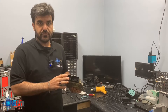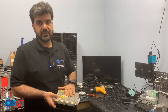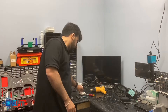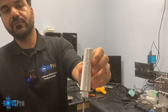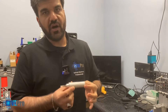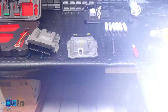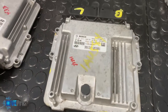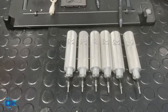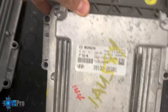We are not going to connect through the pinouts. For these Kia and Hyundai ECUs you require to open up the case in order to connect what's called boot mode. We're going to show you the process using the special Magic Motorsport ECU cover extractor that helps in working with any Bosch ECU. The tools required are a T15, an exacto knife, a heat gun, and six ECU cover extractors.